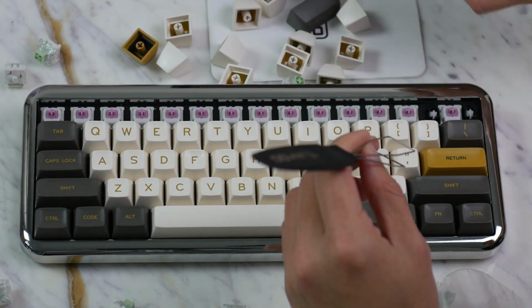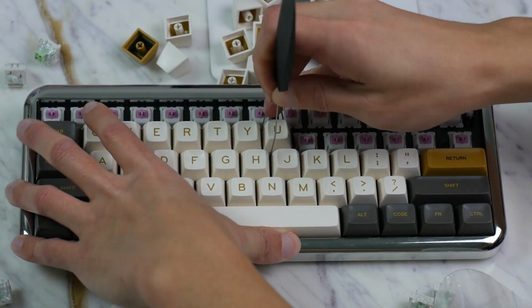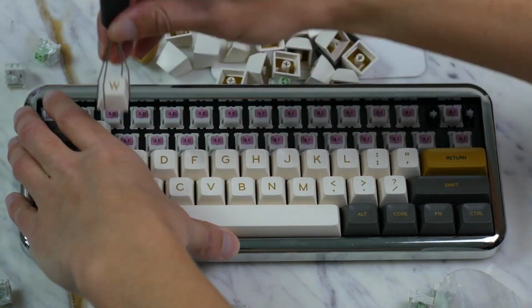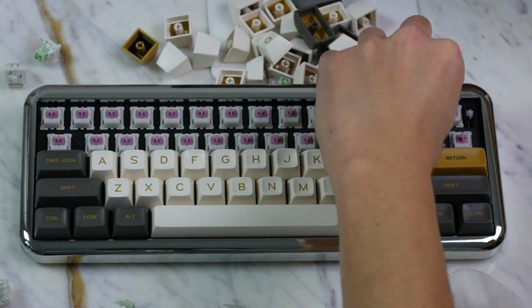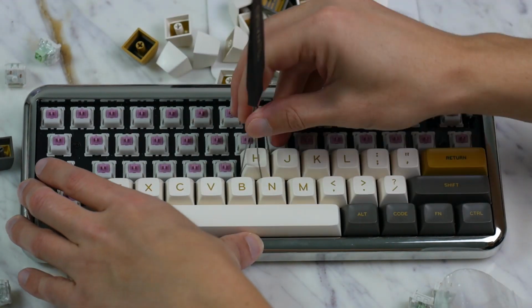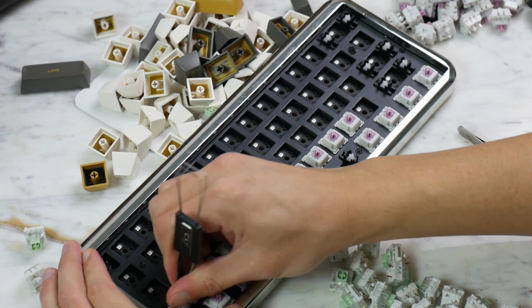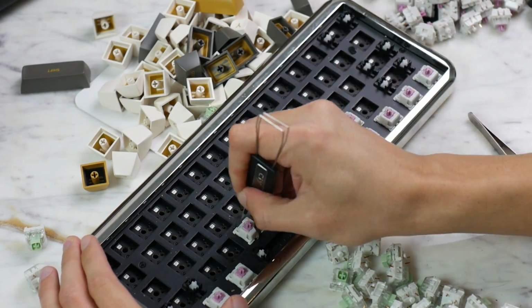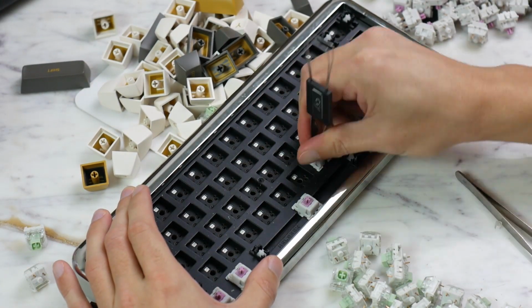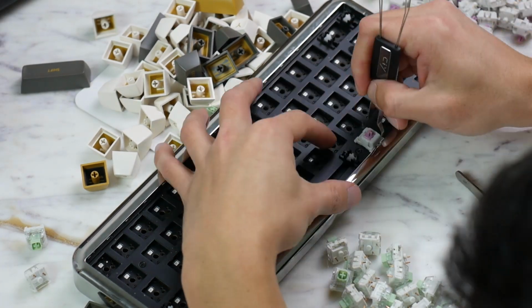First thing I did was swap out the yellow Gateron switches that it came with. You get a choice when ordering. I went linear because honestly, I've been missing linear switches lately. I found them to be way too light with these SA caps, and in general didn't like the yellows. Go red. If you're trying to choose between yellows and reds, go red. They just feel slightly higher in quality.